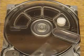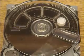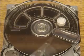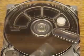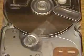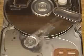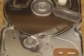This is the speed it would typically operate at. After this, it will switch to random seeks, and the motion looks kind of random, but it's not. It's really picking out a random track, moving to it precisely, locking on, and then moving on to the next one. Here it is doing random seeks, as it would if it was trying to pick up data from random positions.